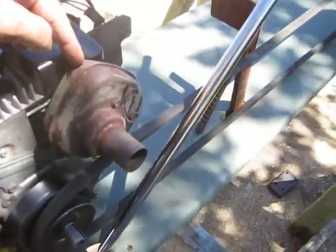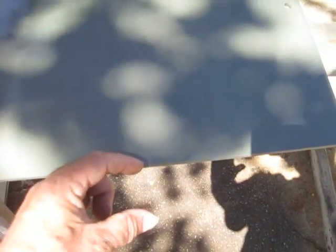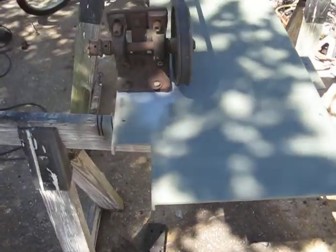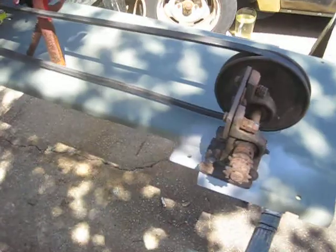The muffler will come off here — it'll be like a little header. It'll come straight out this way and then down, like beside the frame. If I don't do it there, it'll be a hole back here in this area and it'll go down just past this brake pedal, underneath, and come out the back. I'm thinking about letting it stick out maybe an inch and a half, with a little Volkswagen tailpipe clamped on it — I think that'll look pretty good. Just put a small muffler underneath it — a little lawnmower muffler. Sound a lot better, a little quieter than just sticking out like that.